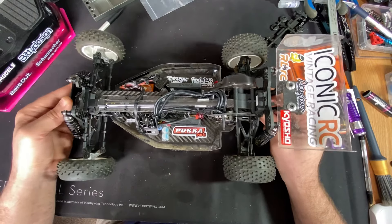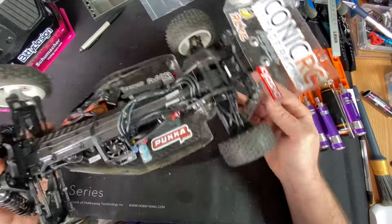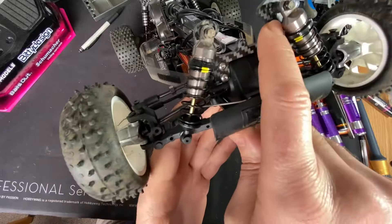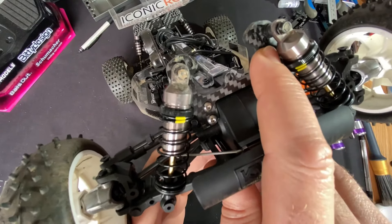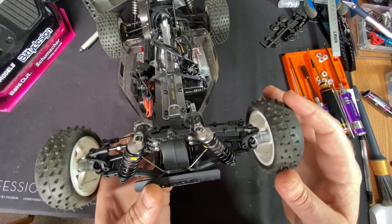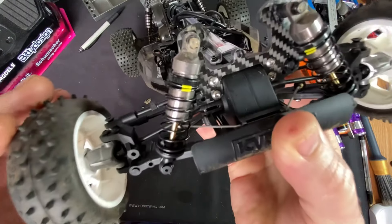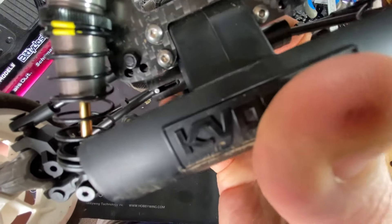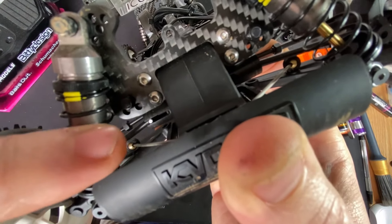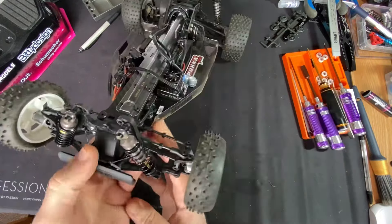Just making sure the lunch box was all fine for the endurance event coming soon. The only other issue was the very inner lower shock mount — it had too much droop, and basically what would happen is the drive shaft would come out, mainly on this side. You can see where it sits now — the end of the drive shaft is just barely in there.